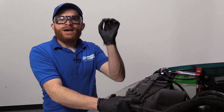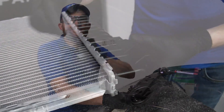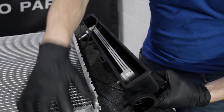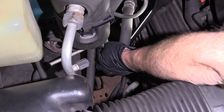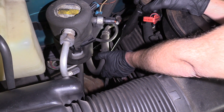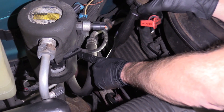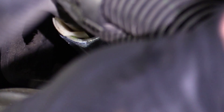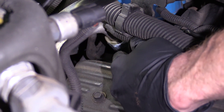Another thing that might leak is the radiator itself — there's a seam where the tank connects onto the finned aluminum area, and it's very common for that seal to leak. You can generally see that during a pressure test along the side. Along the backside of the engine near the firewall, you'll find your heater hoses leading into the firewall where the heater core is — located right behind the glove box on most vehicles. A leak between where the hose connects there or on the heater core itself will more than likely show up as wetness on the passenger side floor. Following the heater hose to where it connects into the engine is another common leak area.